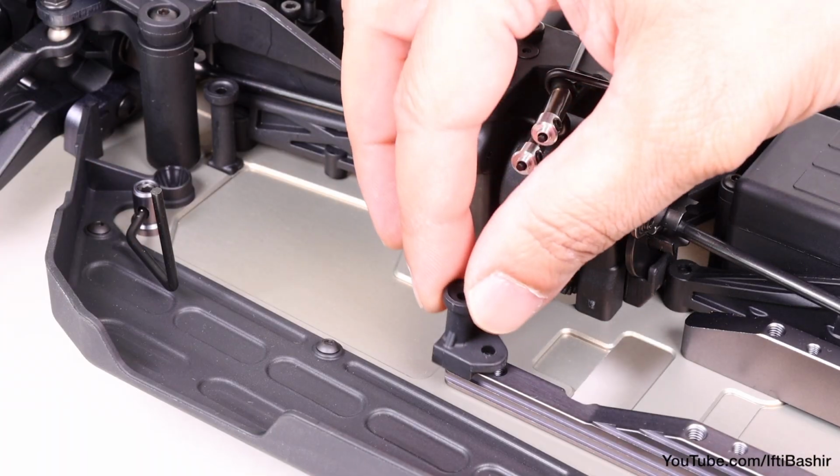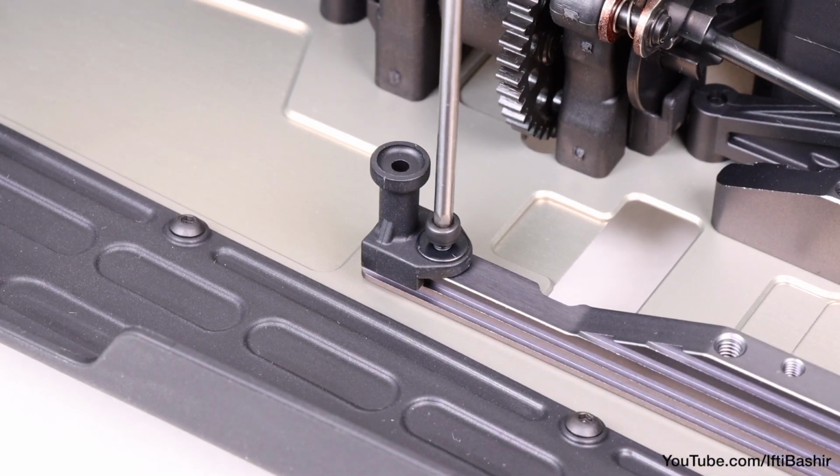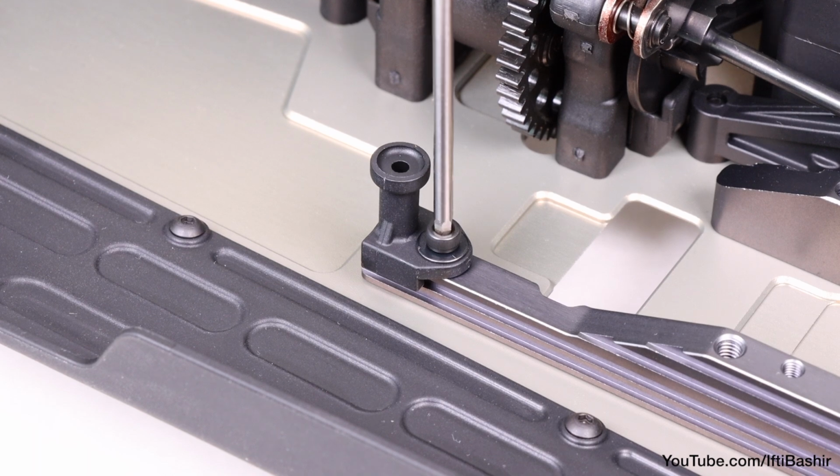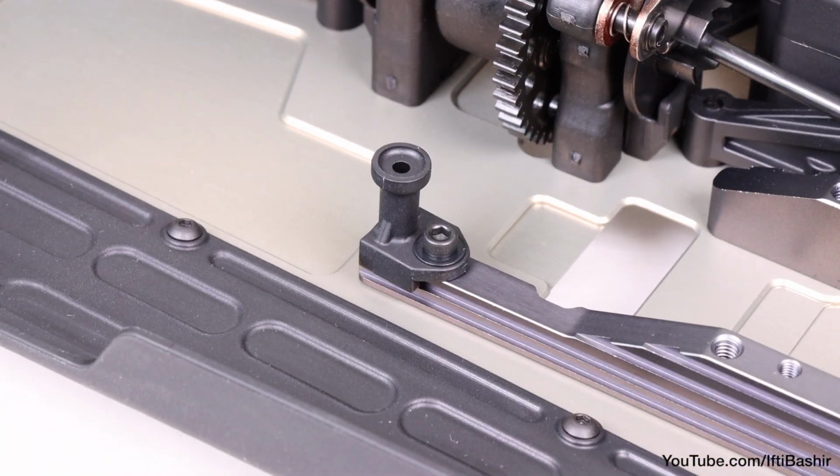And the second sits on the engine mount itself, secured with a 10mm caphead screw complete with 6mm washer, going into metal here so thread lock is required.